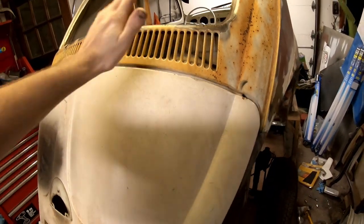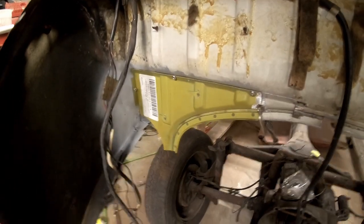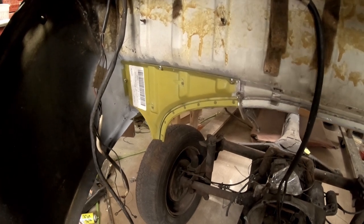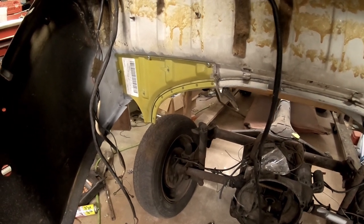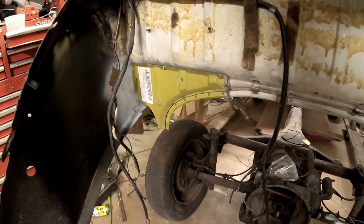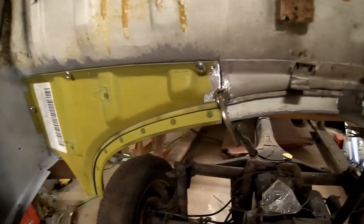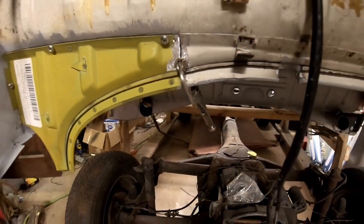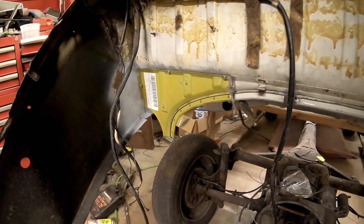I want to adjust the lid, make it fit the apron. If I open this, you'll see this one, last week, I was worried it was in the wrong spot. It was in the wrong spot. I was able to take the old one that I still had, because you save all your parts, put it on the marks where I ground it down, traced it, put the new one there, and wouldn't you know it, when you put the new panel where the old panel was, all the numbers start to line up. Now, the new panel is not exactly the same. You can see the gap's a little wide at the bottom there because I cut it based on my original measurements, which doesn't matter. It's where it needs to be now.